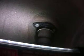So a lot of these cars, and I saw this when I was test driving, you'll look under here, and all this metal is completely torch cut out, and like a new shock tower is welded in over here. There are good ways to do this and bad ways to do this. Have a pre-purchase inspection done, especially if you see one of these hack jobs on the shock towers.